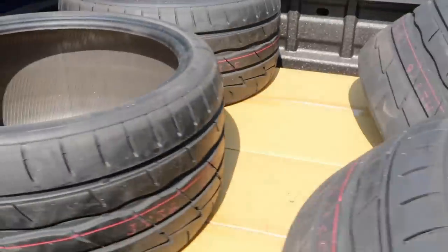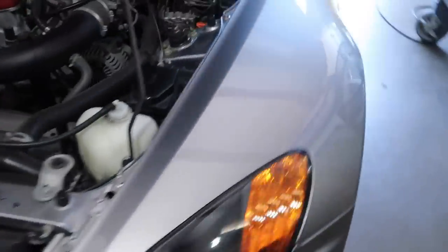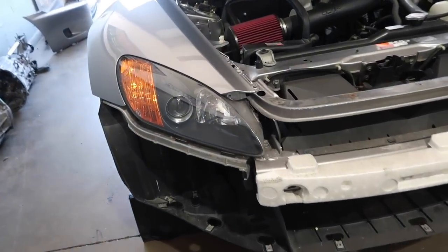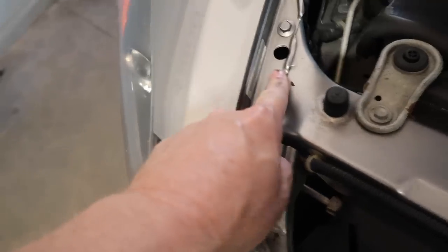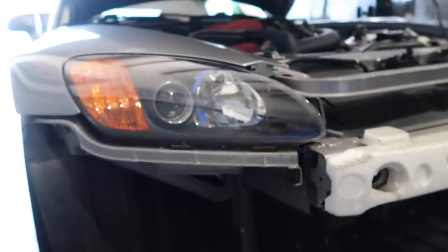Taking the wheels and tires to Carlos and will be back. Last thing the car needs is the retainers and keepers. To take the bumper off: there's an 8mm here, five bolts across, a 10mm in here, and a bunch of 10mms across the bottom — then the bumper comes off. You have to remove the bumper to access the headlight, then take out the headlight by removing a 10mm down there, two 10mms, three 10mms, and one underneath.